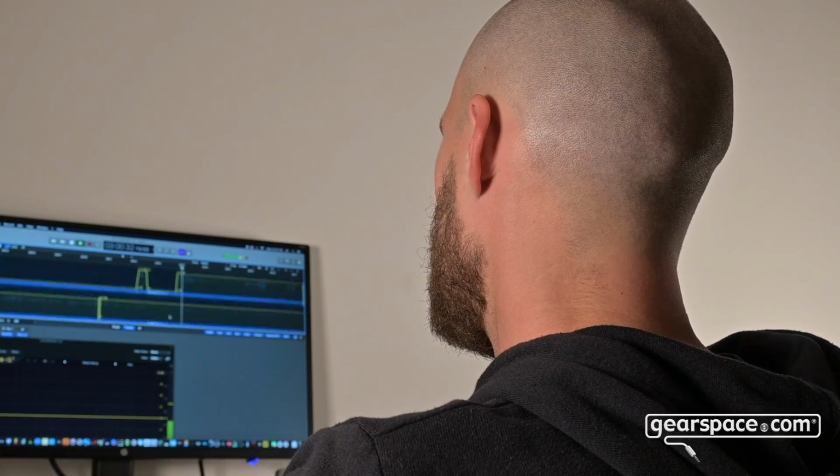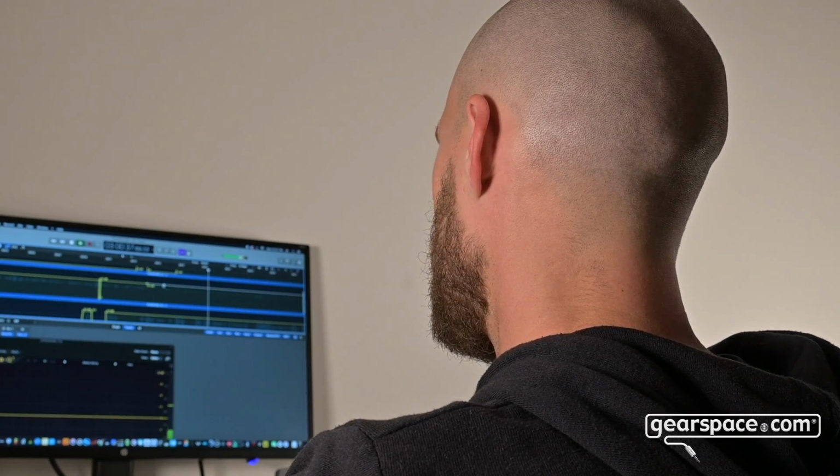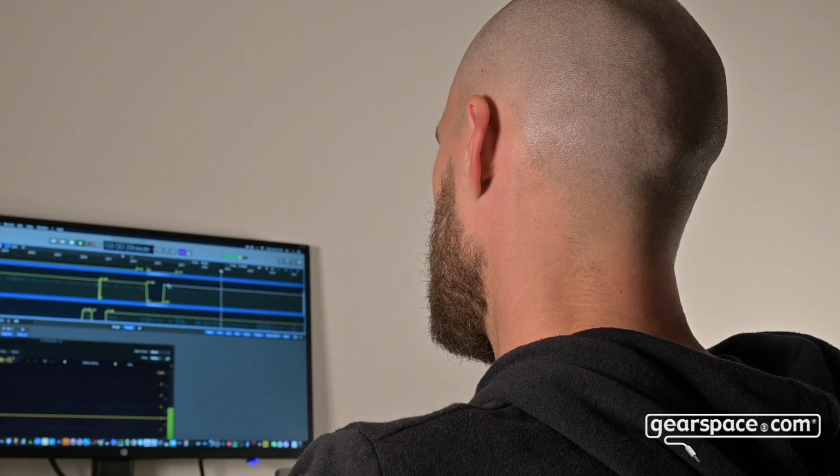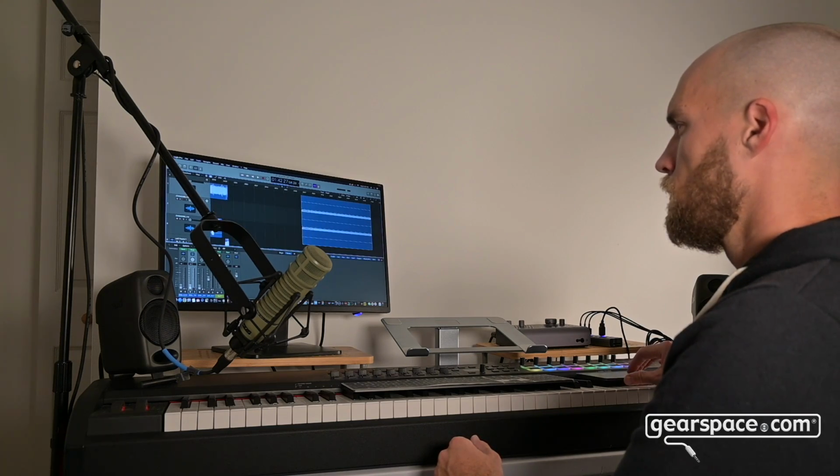With 120 dB max SPL, the WS-6.2 provides more than enough sound for my room. But if you need even more, there is always the option of adding another WS-6.2 or trading up for the WS-12, which is a 12-inch woofer. As a bonus, the fact that the woofers are horizontally opposed means that the unit won't start vibrating or scooting around if you really crank up the volume. You get reference level audio out of the WS-6.2 if you listen from anywhere within 4 meters.